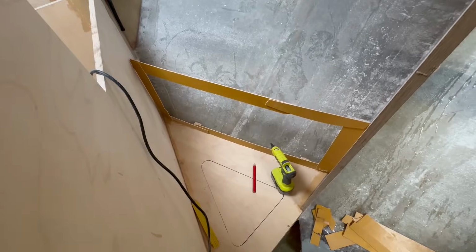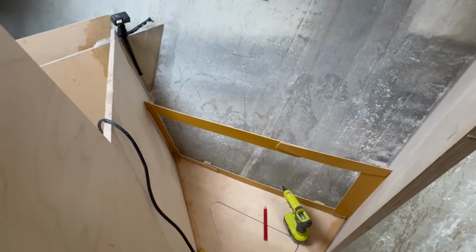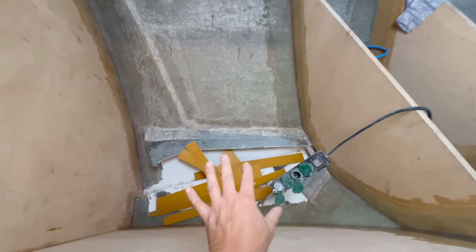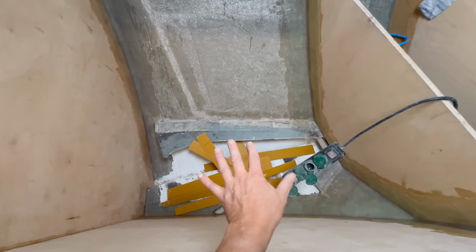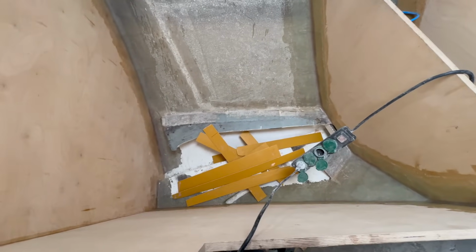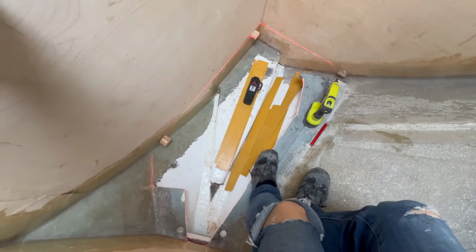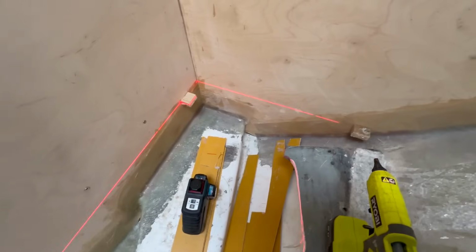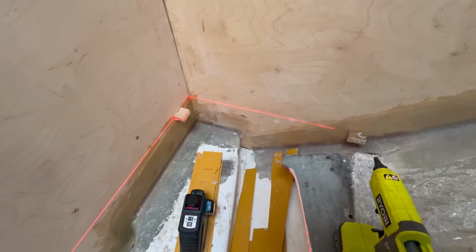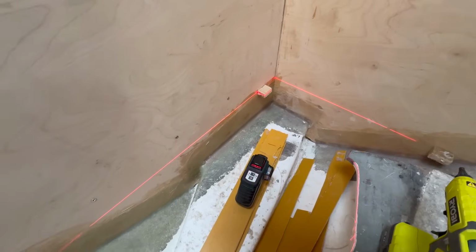Right, so the next template is ready, and let's get it out and just continue. Then it is this template. It's for underneath the bed to rest the water tank upon. Right, so this floor I will put on top of the old floor, and it will just be a few millimeters higher, 18-20, something like that, which seems to be okay for the tank.